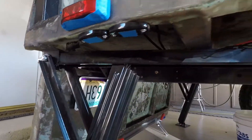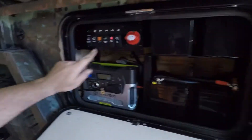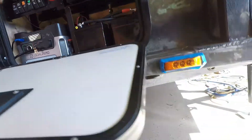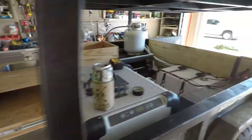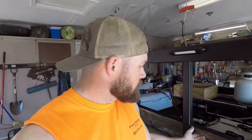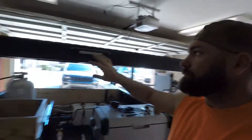Down here I have rock lights in both white and red — the red lights are right there. The exterior lights are white and they go around: one on the front, two on either side, one on the back, and two on the other side as well. Those are wired so I have to have those lights on in order to run this light. I only did that because I had already wired it in and was running out of connection points on my block.